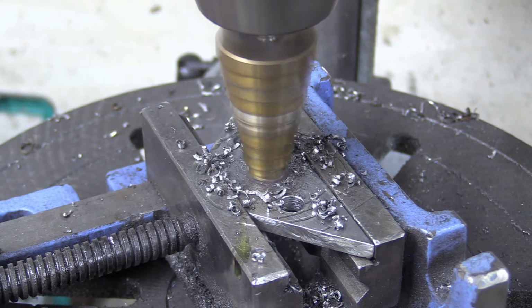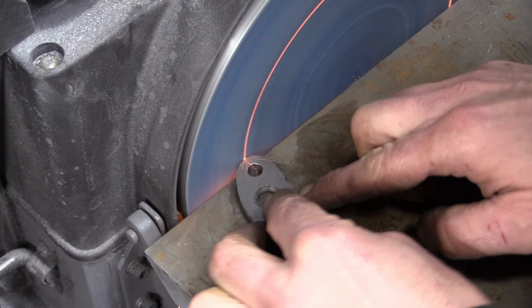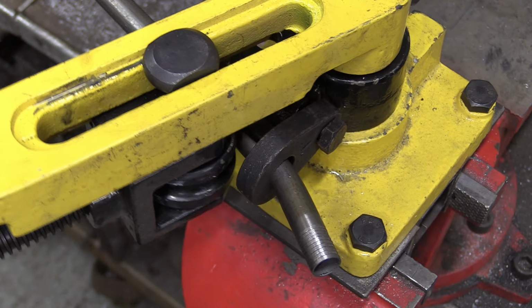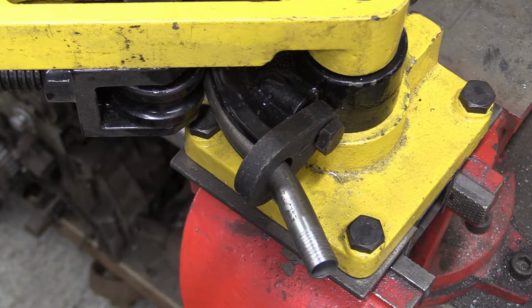Equally as important is the oil drain. The correct size and routing of your oil drain has a marked impact on the longevity of your turbo, so we're making our own to be doubly sure. There's three parts to ours: the top tube, which bolts to the turbo, the bottom tube, which bolts to the sump, and the wibbly bit in the middle, which connects the two.